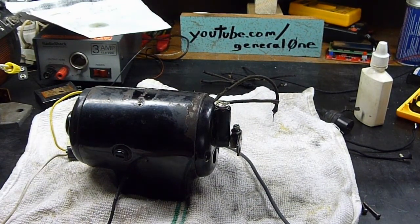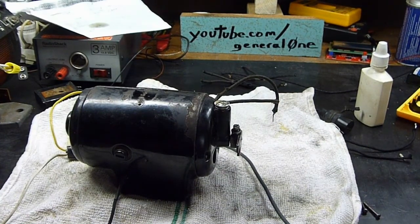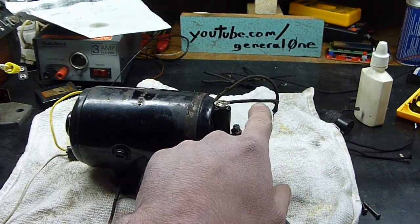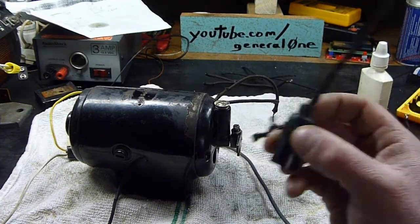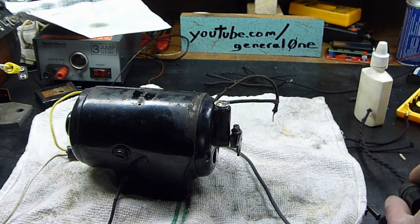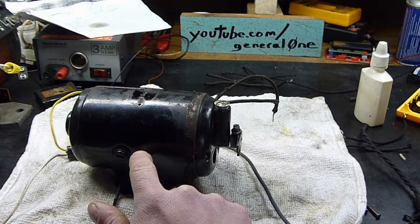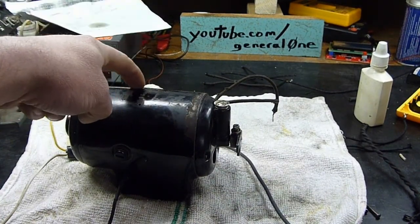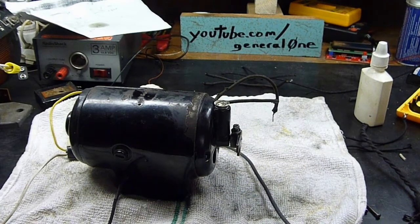The other wire going in here goes to one of the wires that comes out to the front, which goes to the plug switch on the machine, then goes back into the motor through the coils, and then to this brush terminal. As I said before, the other brush terminal is bridged to the contact on the slip ring, so that one gets its power from there.